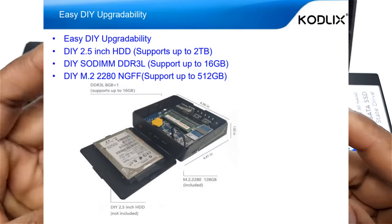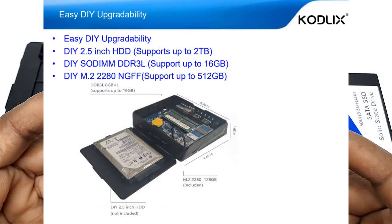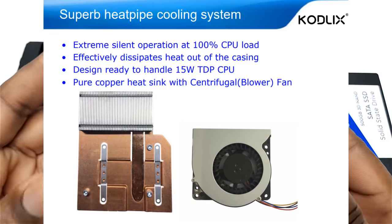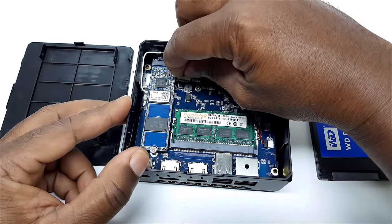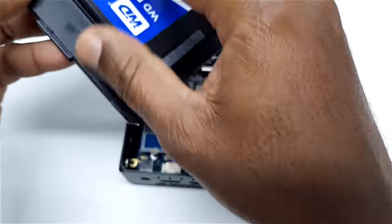On this mini PC you can change out the memory and install a maximum single 16GB SODIMM memory card. The M.2 port can take a 512GB 2280 card NGFF. And the SATA port can take a 2.5-inch SSD or HDD up to 2TB. Below the motherboard there's a CPU cooling fan and heatsink, and it's the same cooling fan design used in laptops. For a full detailed data spec sheet with fan noise and heat pipe reading, along with a detailed test report from the manufacturer, a PDF link was placed in the description area.